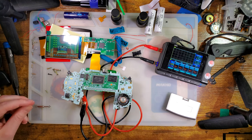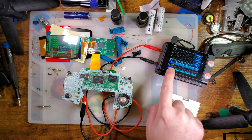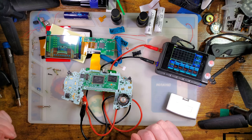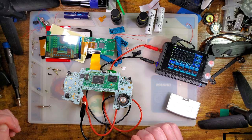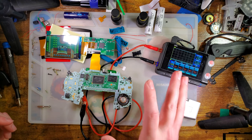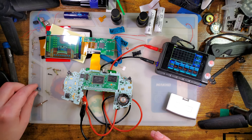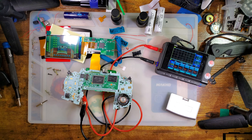Okay. And in the overworld, same place I always test, yada yada. After the mod, 2.4 volts, it is pulling... Oh, that was sharp. 315 to 323 milliamps, which is quite significant. Yes, hello. Okay. Not great, but it's kind of what I expected, especially since I just did the SP version of this kit and power usage was pretty rough on that too.